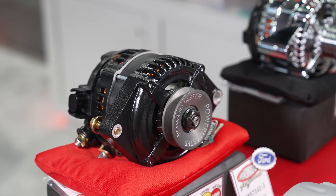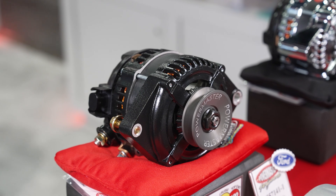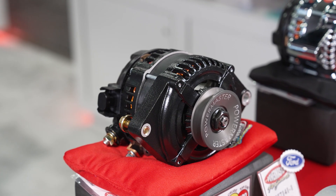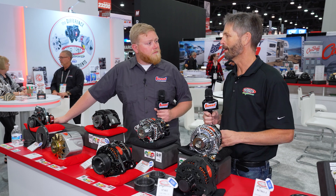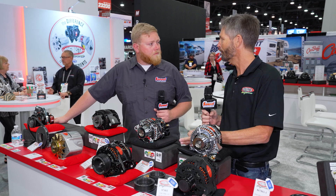The HPR series is a new style alternator — it's a hairpin replacement alternator — but what they're really focused on is making high current at low RPM. We've got electric fuel pumps, dual fans, air conditioning, and everybody likes the big numbers at top end, from ignition coils to alternators. They want to see the high numbers.